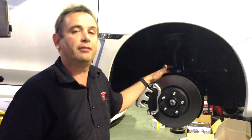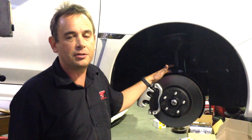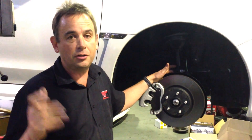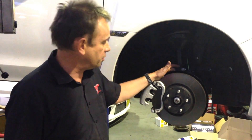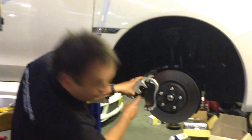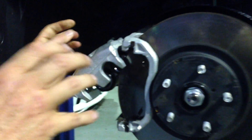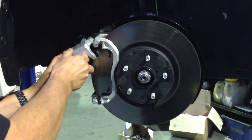For your ease of looking up these parts, if you go to the drop-down menu on our MRT Performance website and click the green button, you can put in MY15 Subaru WRX and choose the option and it'll show you the brakes that fit this particular model. Straight away you can see we've got the brake caliper apart — it's got a twin piston sliding caliper. I'll get my cameraman in there close, so you can see it's got twin pistons on the side. It's not like some of the older models that had a four piston fixed caliper — it's actually a sliding caliper that slides in and out.